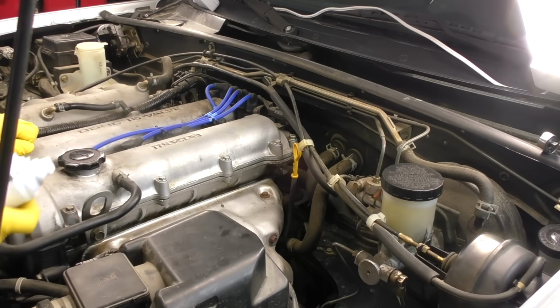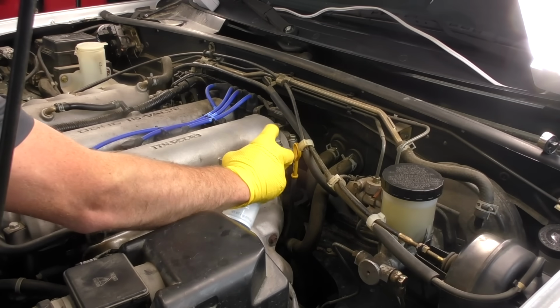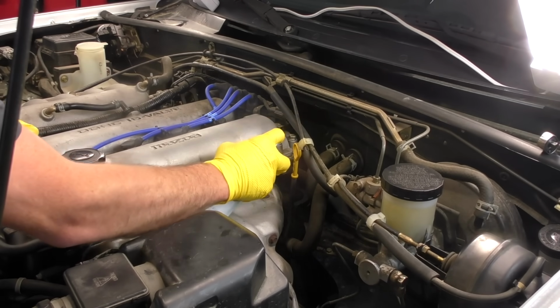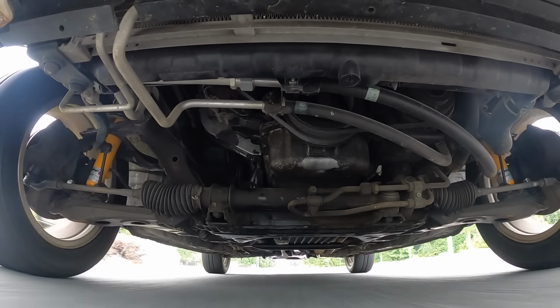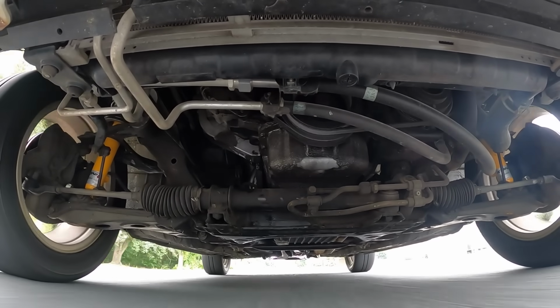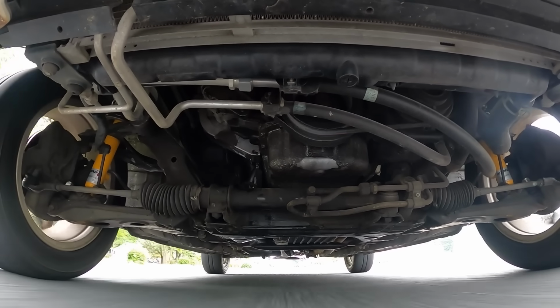Let's use our spray first. We're gonna spray that powder right on the area where we're chasing our leak. We'll use the spray in the same way we would as if we were spray painting something. Then we're gonna do the same thing that we did with our engine oil dye. We're gonna drive the car or let it idle for a while and then trace our leak.